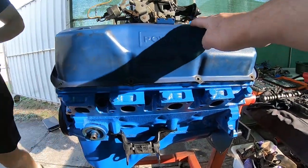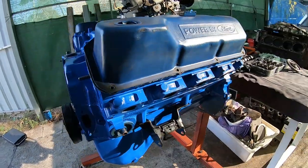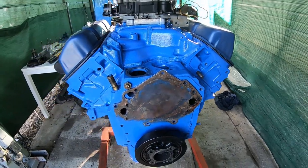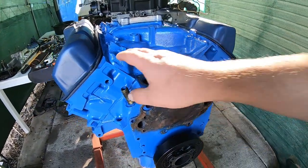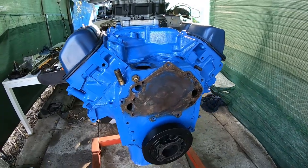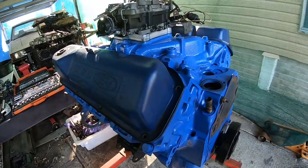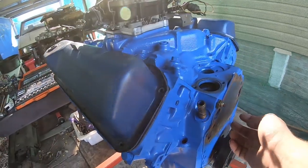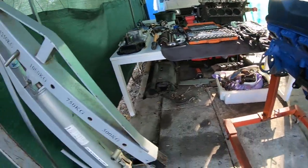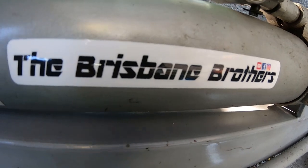I would estimate this engine would have been in the vicinity of about 260 to 280 horsepower as a reconditioned, high-compression 351, 30-over, with good pistons. We saw all the paperwork when we bought it — the guy spent seven thousand seven hundred dollars on it; it's not cheap. It was built for reliability. It's a shame we have to pull the timing cover off, but because we're opening it up, we're going to do some upgrades. Make sure you smash that like and subscribe.